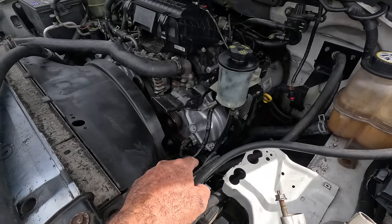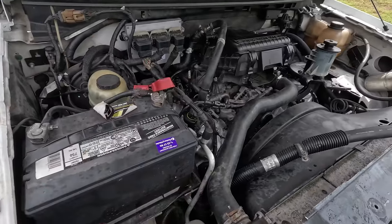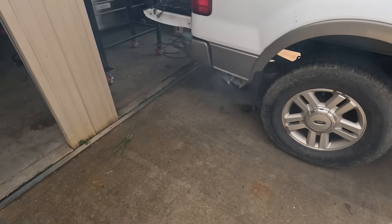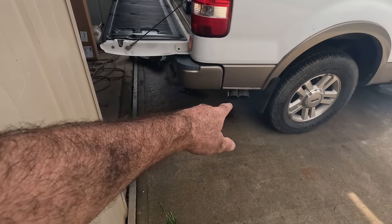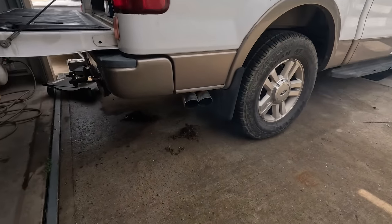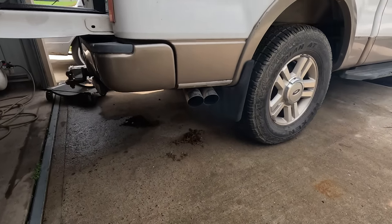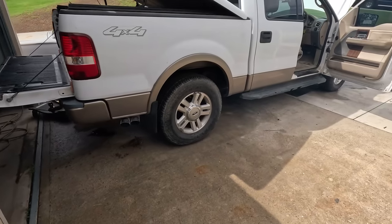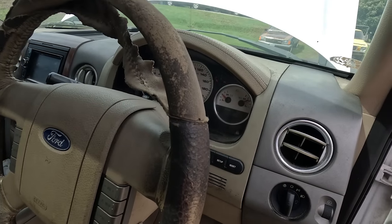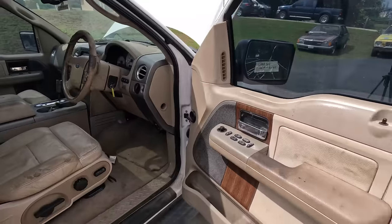Sounds of it, that power steering pump still wants a little bit more fluid. But I'm not hearing any ticking, any chattering. Little bit of smoke. But I'm not real concerned about the smoke just yet, because think of how many times that was wound over with cylinders that weren't firing because of those phasers in the wrong position. Think of the amount of fuel it would have had. So he might smoke for a little while, but I'm just going to let him idle, let him learn. I got nothing on the dash. I got an engine light, but that doesn't surprise me, and I'll explain why.